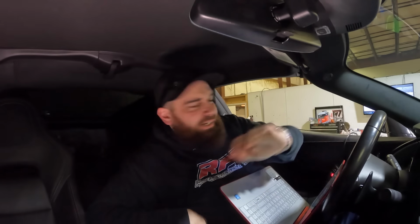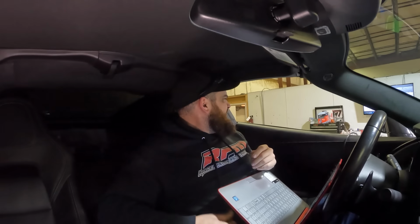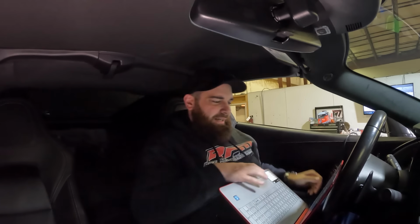It makes like the exact same boost the entire time, but right at the end, obviously because of the air intake, it creeps up, makes like another pound over stock. Generally with headers it would decrease boost, but the air intake is going to increase it because it's less of a restriction. On both parts, less of a restriction going in and coming out, so it's about equal. But right at the top, the stock air intake with the stock filter is fairly restrictive, so it makes like another pound up high.